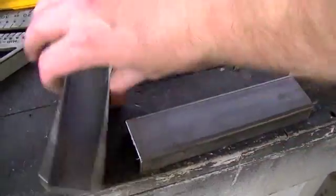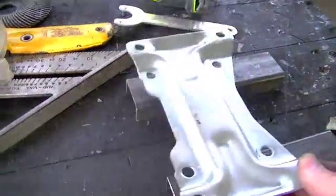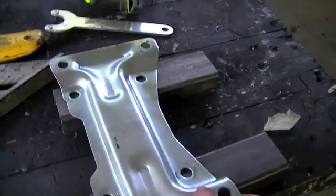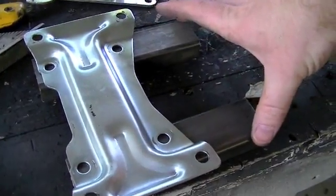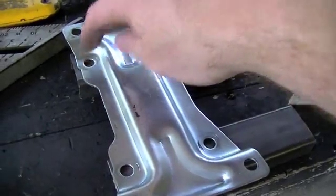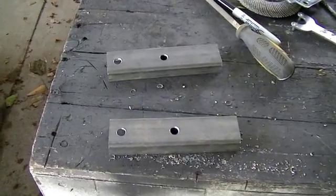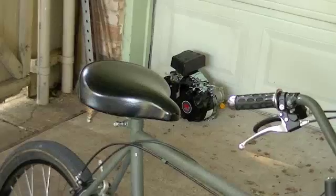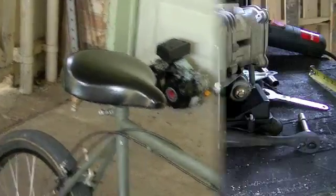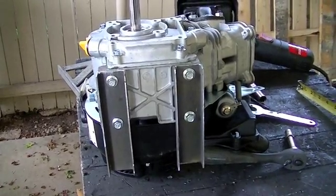There we go — we got our two little extension pieces. They're just a piece of one-and-a-half inch square tube cut in half. I'll show you how they're going to work — set them up like that, take my engine plate which is a fantastic template, get these the proper distance apart, then come in and mark and drill those holes. Here are the new extension arms with the holes drilled. I'll get the bolts and bring the engine over to bolt it up and see how it fits. Here's a quick bottom view of how those extension arms mount to the bottom of the engine.